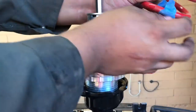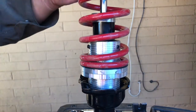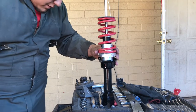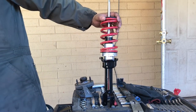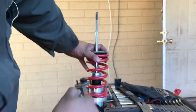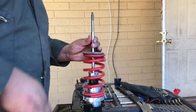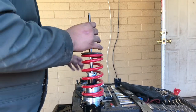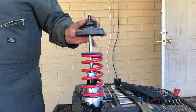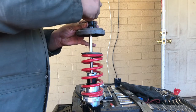We're gonna place the spring on, then go ahead and grab your top hat that came in your kit. Also, on the old suspension there was a washer — make sure you grab that washer and add it on the section, because there's a groove there that makes sure the suspension doesn't go past that point; therefore it's gonna compress it and it won't be as bouncy. Make sure your top hat has both bushings as well, and then place the washer I told you not to lose in the beginning.